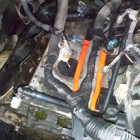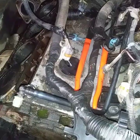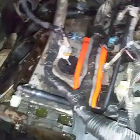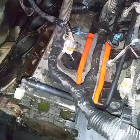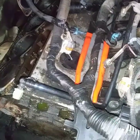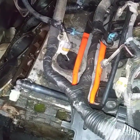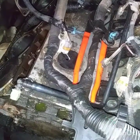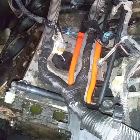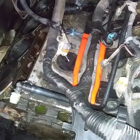So I'm gonna take it over to City Motor Supply, have them do their thing to it, check everything, and then I'll put the new pistons in, since this one already has a hole in it. I'll put the 823 heads on here to give it more flow, and then I have to change up my intake to a square port intake. And we should be rolling in the next 2 weeks or so. I got a couple other things to get done, but that's pretty much it.